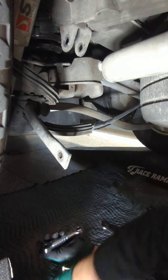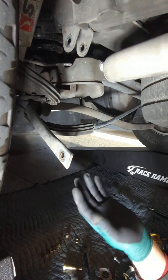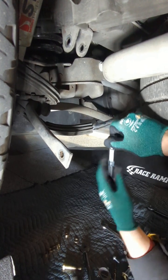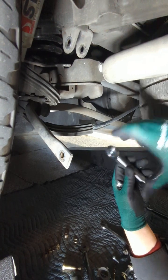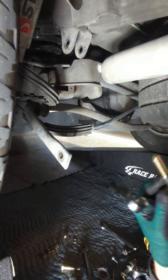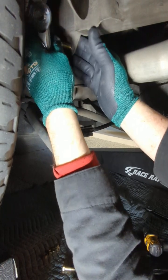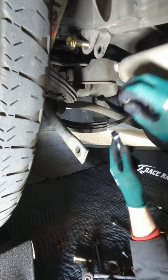So here we go. This truck is about a 5 to 5.5 inch drop. So I'll set these at the shortest distance here. It's 4 7/8. The other ones I have will be a little over 6 inches. That's closer to a 3-inch drop. So easy. You have a washer, all grade 8 stuff I include. You have a spacer, so you have washer, spacer, right? Endlink. Now let's see how this one works out.